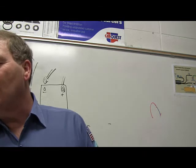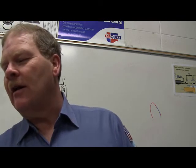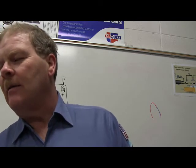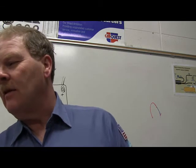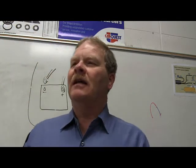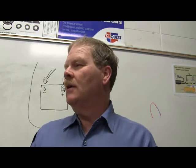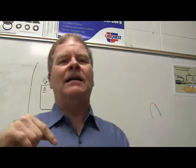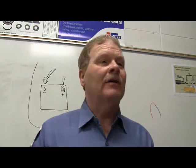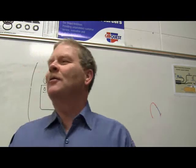A problem in a sending unit could cause a single gauge to malfunction. Could a problem in a sending unit cause a single gauge to malfunction, or could it not? Are you people even listening to me? Somebody give me an answer to that. If I've got a single gauge malfunctioning, can that be a problem in a sending unit? You guys are studying electrical stuff too. I've got nine guys in here right now, and everybody's looking at me like a deer in the headlights. Somebody give me a yes or no answer. Can a sending unit cause a gauge to malfunction? Yes, it could. It could, couldn't it? That's easy. That wasn't even a hard question.